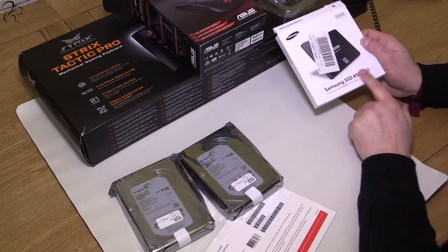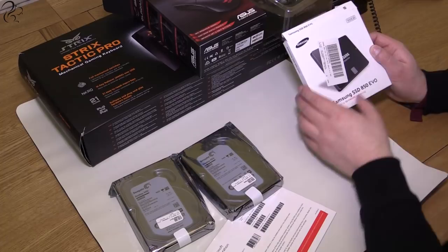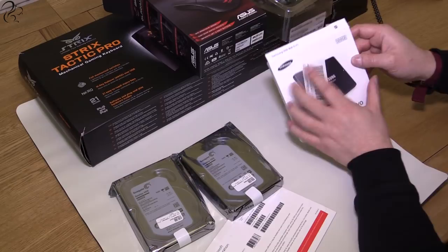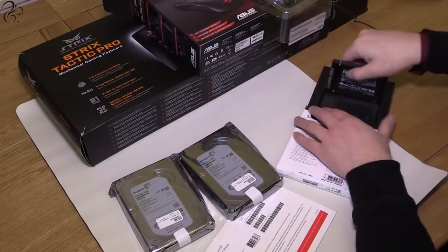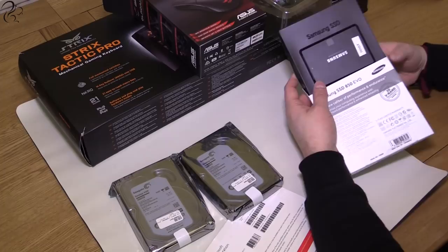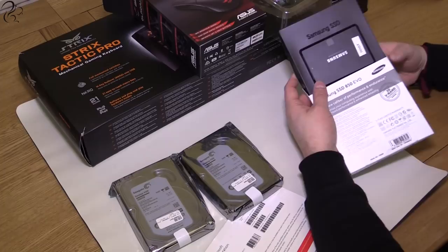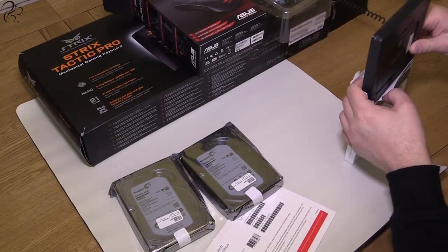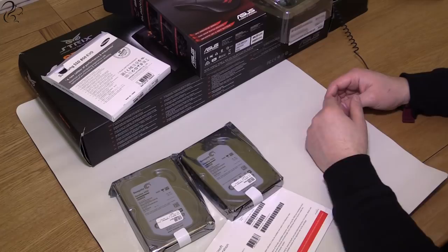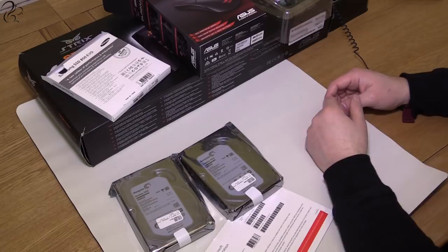For the hard drive, this is going to be my boot drive - the Samsung SSD 850 EVO with 3D V-NAND technology. It's the 500GB version and I've already labelled it 'boot'. There's also a hard drive coming in from my current gaming rig - a Samsung 840 EVO 1TB drive that takes all my games. All my Steam games, FSX and everything goes onto the 1TB SSD, which gives good launch performance when loading games and scenery. You still need hard drives at the end of the day, and I've got Seagate 2TB drives running at SATA 3 6GB, 7200 RPM.